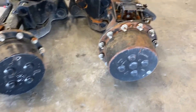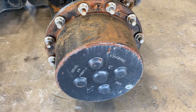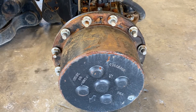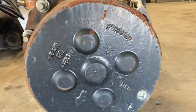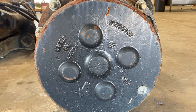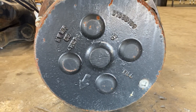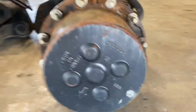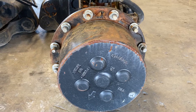The 12-bolt is pretty easy — you count your bolts inside your hub or inside your wheel. The 10-bolt is quite a bit smaller. It also has five dimples and four dimples: the four dimples represent a planetary gear, and the other dimples are where the pinion shaft goes. That's the easiest way to identify it. So we know you've got a 12-bolt Dana front axle.